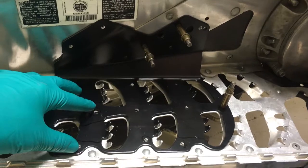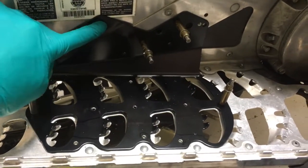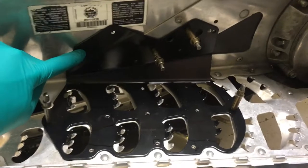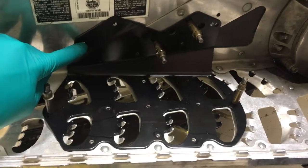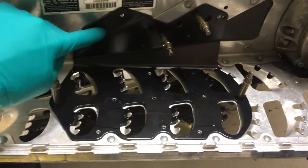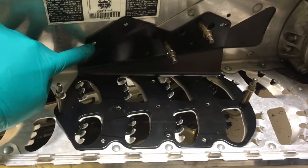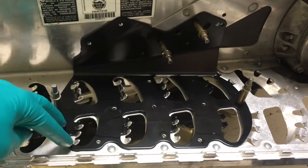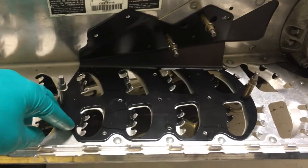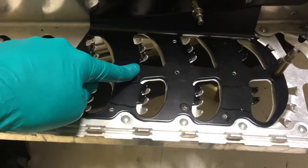When you're drilling your holes, just drill the holes to the size of the rivets. There are rivets that come with the kit, but I'm going to be using some better rivets because I don't like the quality of the ones that come with the kit. Just drill the holes at the marked locations for where you're going to be putting your rivets.